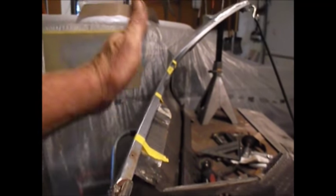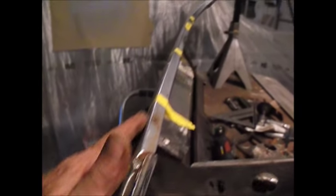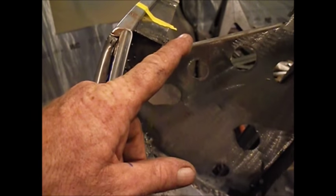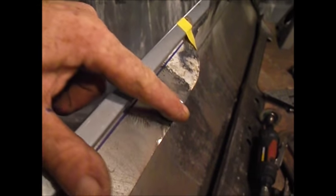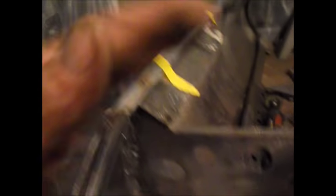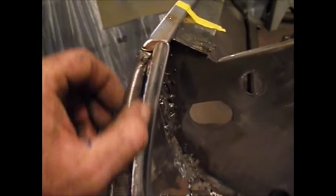I got my trim on there and found out this fender isn't really supposed to be perfectly straight. In pictures it looks like it, but if you look at it at the right angle, you see it does come in towards the headlights just a little bit, which caused me a couple problems. The fender was sticking out, then this eyebrow trim — the headlight goes right in here — the trim was stuck out too long and it was a nightmare. So what I had to do: I had to recut here, cut a slice right in my fender pretty much where I added it anyway, then used a ratchet strap around the whole thing and just pulled it together.